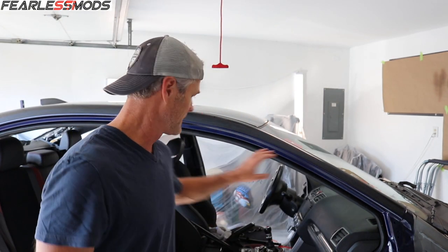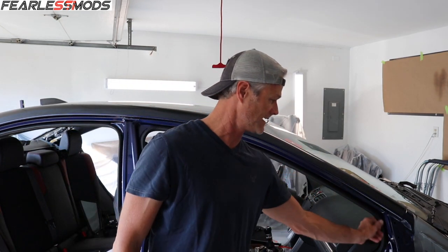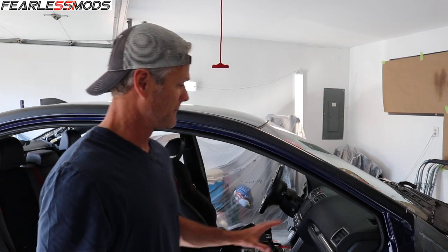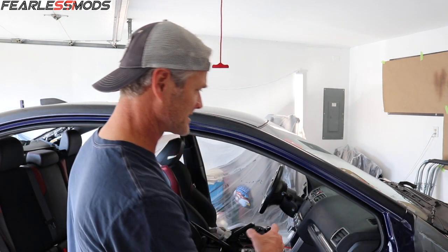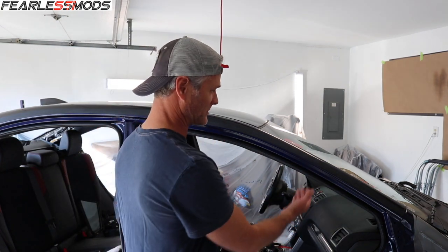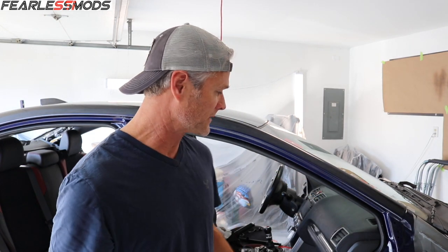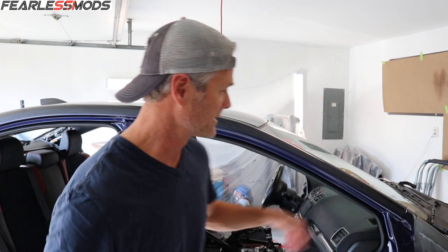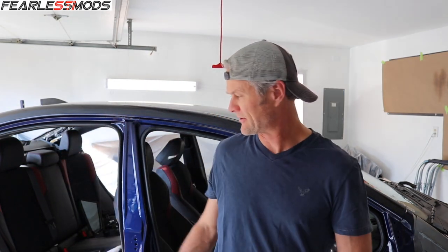Alright guys, it's another new day in the garage. I've gone ahead and got the seals in and the jams — the seals (S-E-A-L-S) and the sills (S-I-L-L-S) down here at the bottom. I've got the hinges already matched up and attached to the doors, and I've put some of the rubber gasketing on the doors. Except for the top portion they're just loosely on there because I'll need to peel those down and tape that up to get some spray on the inner edge of the window rail. I'm going to bring out the doors now, start getting those installed, then get some fenders on, and then start thinking about getting it down on the ground for sanding on the other components so we can get ready to paint.